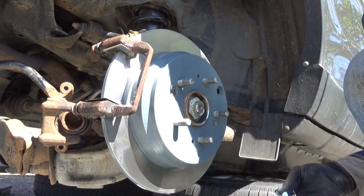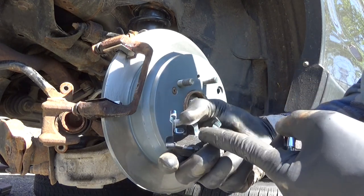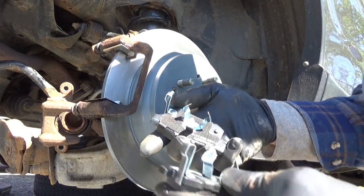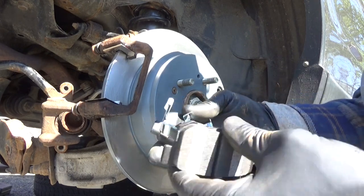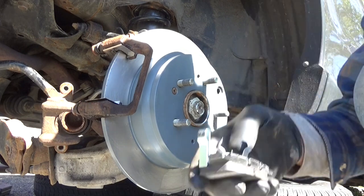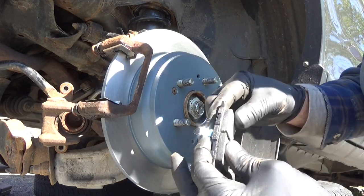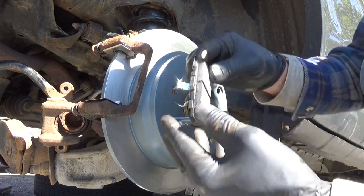Brake pads are a little bit different than what we're used to, because these have got retaining clips that hold it into the piston, and we got a squealer. So we've got a right and a left pad, and again, the squealer always goes on the leading edge. Leading edge in this case is at the bottom. This is going to be on the inboard.